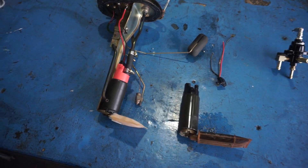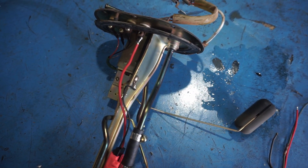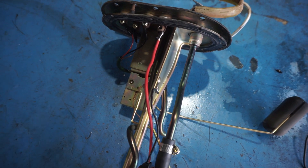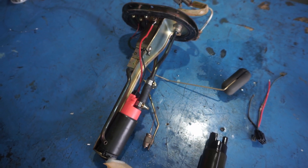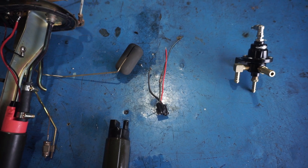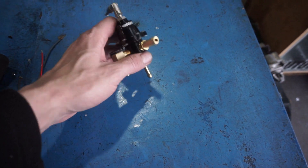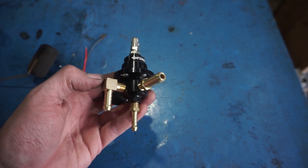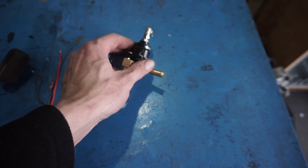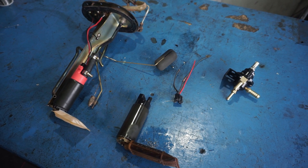Moving on to the fuel system — we'll be using another Raceworks EP501 fuel pump. Since it was a petrol sender we've wired it into the factory power lug. The power wire is never long enough so you're better off running a new piece of wire down to the plug. I'll be using a three-port regulator mounted to the firewall — 8mm inlet, 10mm to the rail, and 6mm for a return. It'll all be plumbed up the same as the manual so we won't go over that again here.